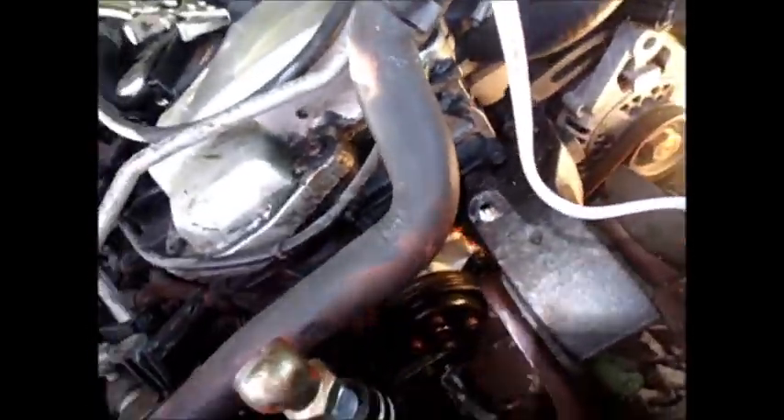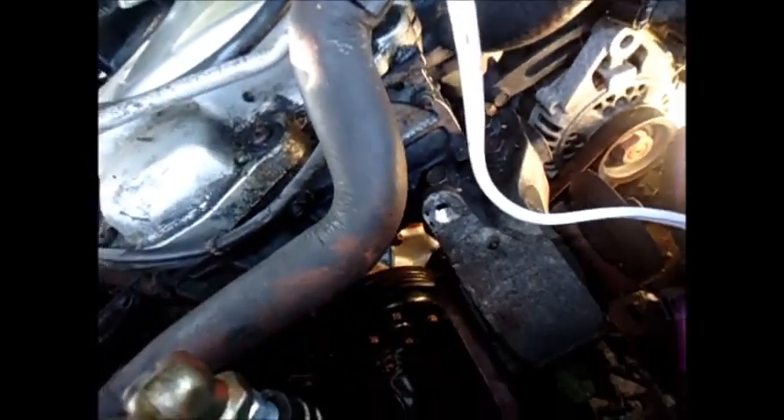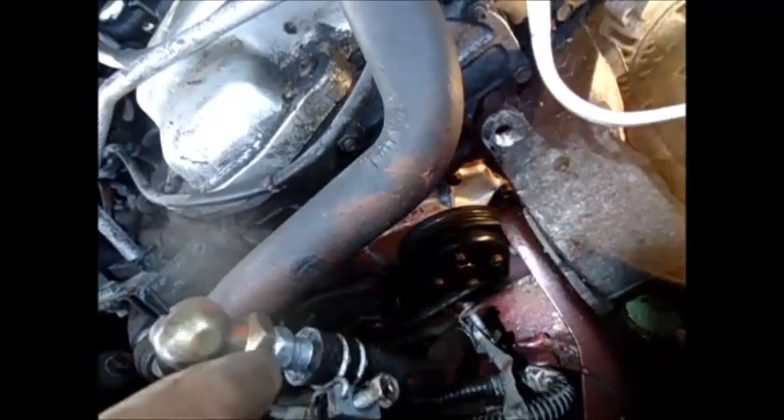Okay, got it. The way I did it, basically, I put a little bit of tack glue up in there, tried to line it up as best I could, held it for a second, and then it stayed on that water pump shaft. Then I could basically use one hand to thread those bolts in. I had to get underneath to loosen up that power steering pump action, and I'll have to go back under there and tighten it up as soon as I get this belt on. Then we'd be done deal.